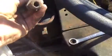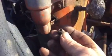So I have to find where the oil pressure gauge comes off this motor. Well, I disconnected the line from the oil pressure gauge, and I'm going to hook it up to my oil pump here in the bucket so I can pressurize the oil system. And I didn't think of a fitting to hook the hose up there. But I pulled this little fitting off, I believe that was some kind of a primer, ether primer or something originally. But I got this little fitting that I should be able to screw in there. And even though it's six-sided, I should be able to clamp that hose onto it to pressurize the oil system.